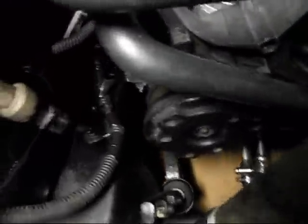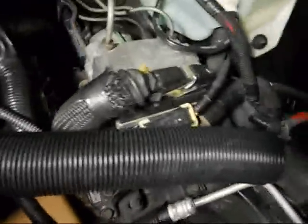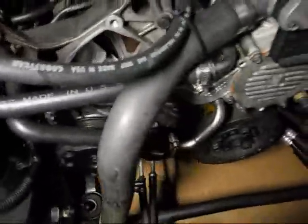Still have this thing apart. Cleaning my belt — use soapy water, rinse it up real good. This belt probably only has about 1,500 miles on it. The one I had before actually tore — got all chewed up because it was slipping. I ran a crappy belt tensioner on a brand new belt, so that was my problem. Cleaned up a lot of the power steering fluid and transmission fluid mess. That stuff takes the wax coating off the frame, so I repainted it a little — it'll dull out with heat.